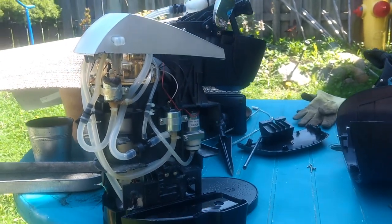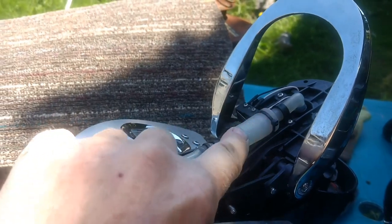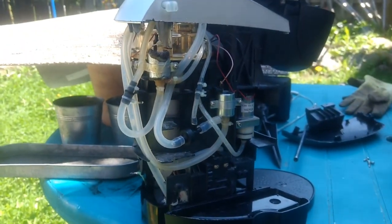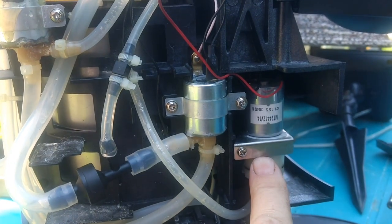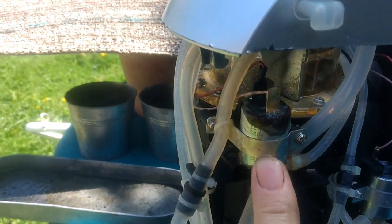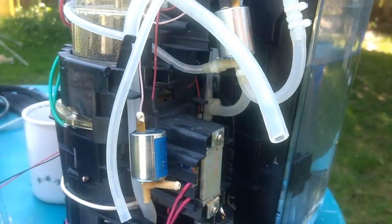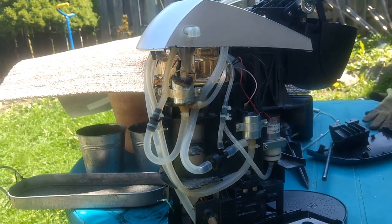Here's another dead unit somebody gave me. It was plugged — I've already unplugged it — plugged up where the water goes into your cup. The one-way check valve I took out of there too; I've got to put it back in. This is a model B60. The water pump on it is the original pump that was in my unit, but they sent me the wrong one. This unit also has a couple of solenoids — there's one there, and look at this one — it's rotted out terribly. I'm going to pull them out and see if they match, then put the good one back in my K70 and order two replacement solenoids.